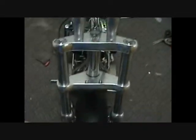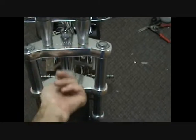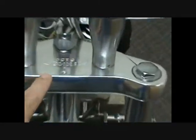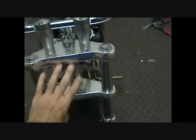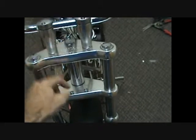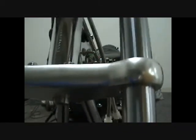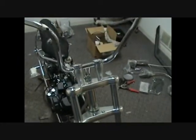When we got to the triple trees, we found they were flipped upside down completely — where it says 'kicker' was on the bottom side. We had to disassemble it, flip the whole thing around, and make sure the threaded rod comes up through the neck with the main bolt on top. There's a large Allen head on the bottom and a set screw on the backside to hold it in place.